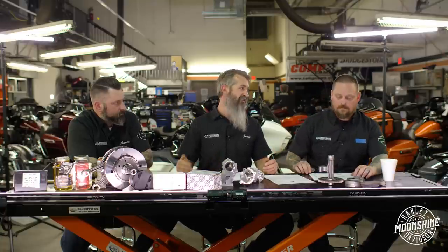Would you put heads on a 475? No. The 521 or 538 - absolutely. When you're adding heads alone you're talking $1,300 to $2,000 for the head, then pairing it to a different manifold or larger throttle body. If you're going to spend that kind of money, go to the next cam step - especially since M8 cams are $280 to $350. Spend the extra $300-$400 and get the cam that matches the head setup.